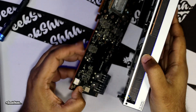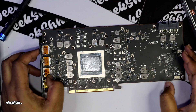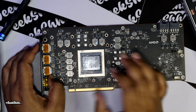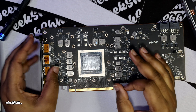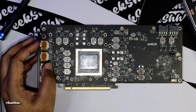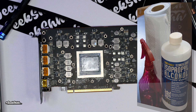Alright, so we've got the Radeon 7 open — that's how you open the card. Now if you want to repaste it, you just have to clean this up. If this is the first time you've opened a card, there should be graphite on there — it won't be paste, it will be graphite — and you have to use something plastic like a credit card to peel it off with some isopropyl alcohol and scratch that graphite off. Then you can paste it. Since I've opened mine before, I already put paste on it, so let me clean this off.